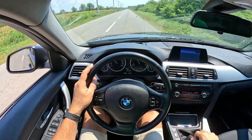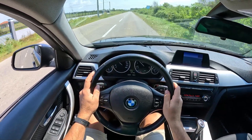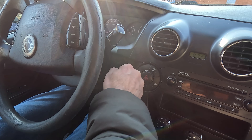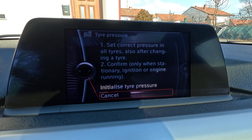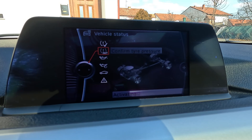The next step is to reset the TPMS. Sometimes the car will do this by itself after you've driven it for 5 or 10 minutes at around 50 miles per hour, but if that doesn't happen, you'll have to reset the system manually. Some cars have a dedicated TPMS reset button somewhere on the center console or under the steering wheel — turn on the ignition without starting the engine, press and hold the button, and wait until it blinks a couple of times before releasing it. At this point the warning light should go off. In most cars, though, the controls for the TPMS are integrated into the onboard computer, meaning you'll have to navigate through different menus. If you're unsure how this is done, consult the owner's manual or leave a question in the comment section below.